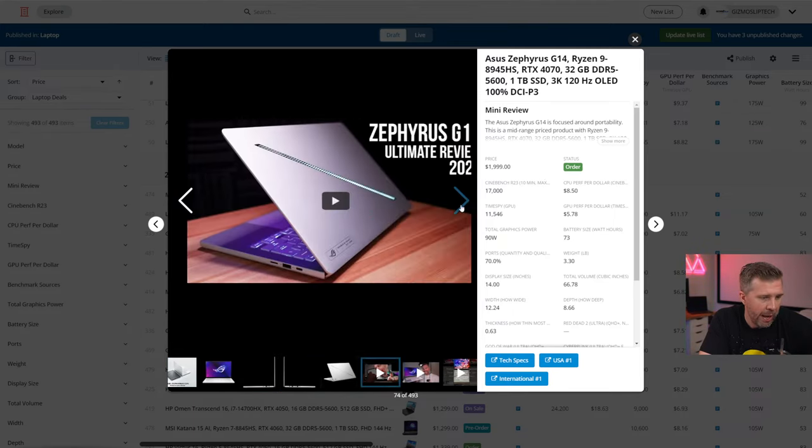And aim to the right a little bit. There we go. Write speed was faster on the G14. Copy speed was again faster on the Omen. Latency, which is very important for gaming, for reducing 1% lows, was better on the G14, though. So these read, write, and copies are more important for game loading, whereas latency is more important for ensuring no stuttering or less stuttering.